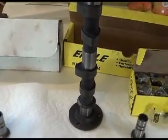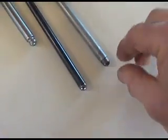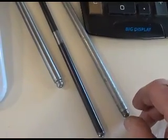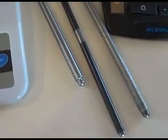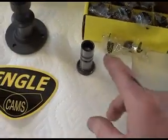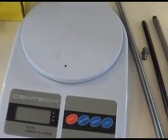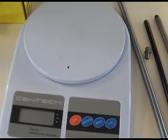That's why you go with heavier springs and as light a valvetrain as you can. I've seen stock pushrods where the steel ends start pushing into the aluminum — it'll flare out, it'll change your valve lash. It happens gradually. If you want the valvetrain to follow the cam profile at higher RPM, you have to increase spring pressure. When you do that, you also have to strengthen the pushrod, and it helps if you can lighten the lifter. Done sloppily, your engine will still run — it's the difference in how long you want it to run well.